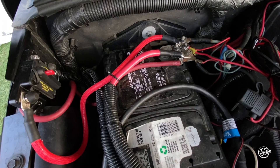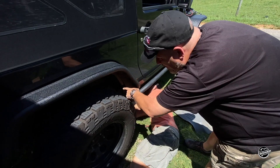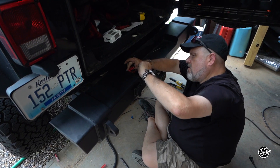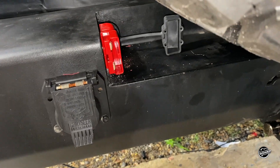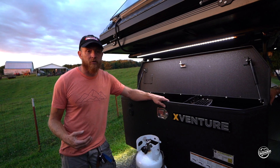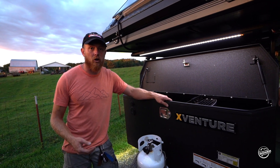On a circuit breaker from the front of the vehicle, we ran back to an Anderson connection that's different from a seven pin. Seven pin hots don't actually charge trailers, and that is really some misinformation that a lot of the overland market struggles with. So with that extra wire, we're able to power our RedArc and give our batteries full charge.